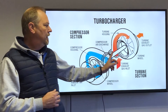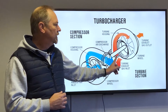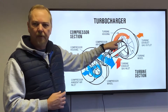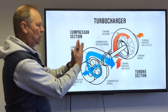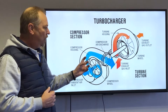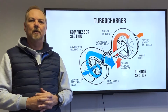If we have a look at this diagram, it's a very simple layout of a traditional turbo. On one side we have our exhaust gases that come through the manifold and spin the exhaust turbine. This turbine builds up more and more RPM and is connected via a shaft to the compressor blades, which draw in air, compress that air, and force it into the engine — sometimes called forced induction.